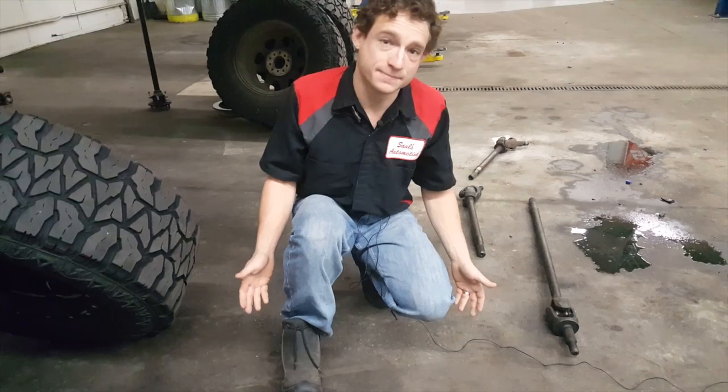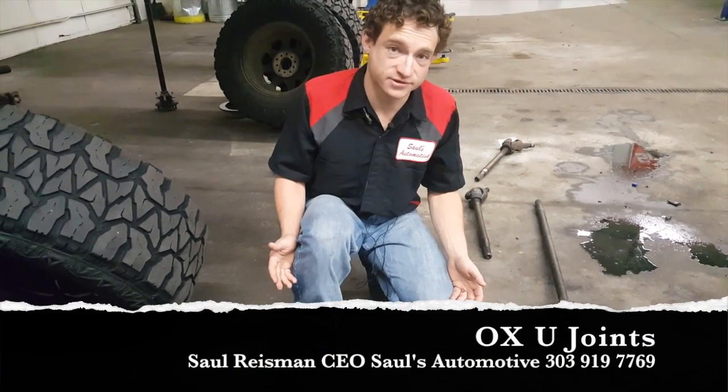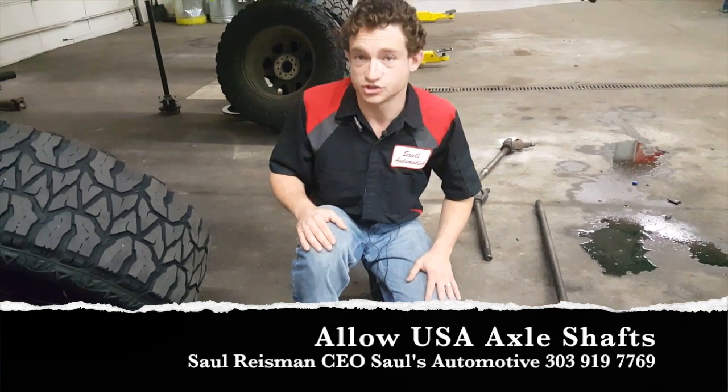So to prevent this from happening in the future, we're going to be installing Ox brand U-joints, which are guaranteed for the life of the vehicle, parts and labor. Additionally, we're going to be installing chromoly 4340 steel alloy axle shafts.